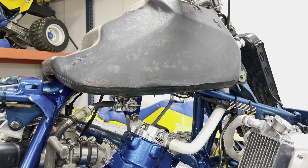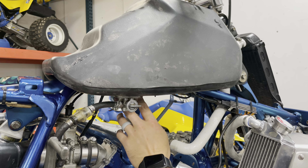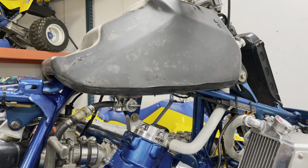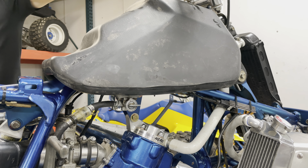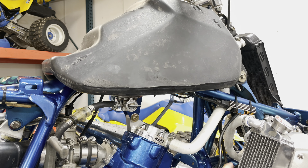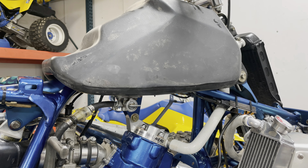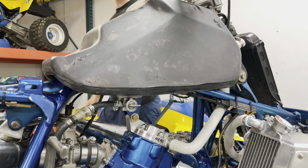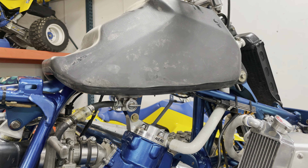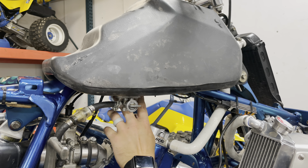This is where my problems started. I was not getting any spark, and I spent five and a half hours trying to diagnose every single part of the electrical system — testing for continuity, checking connections, removing powder coat from mounts, checking grounds — and still nothing. Eventually my dad and uncle came in and saved the day. They diagnosed the last possible issue: the pickup coil being bad. One of the pickup coil wires was worn thin and no longer making contact, so my uncle pulled a pickup coil from one of his bikes and replaced it.